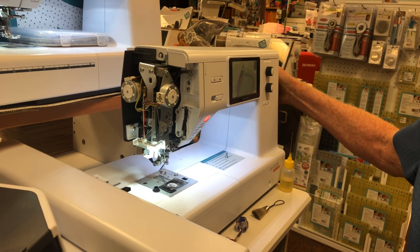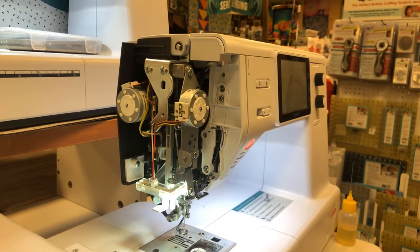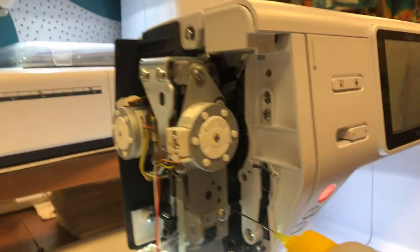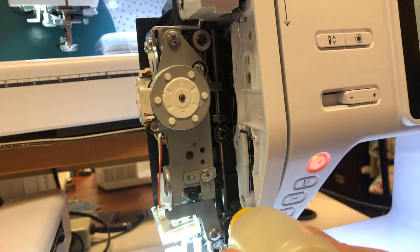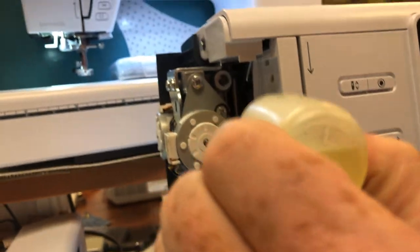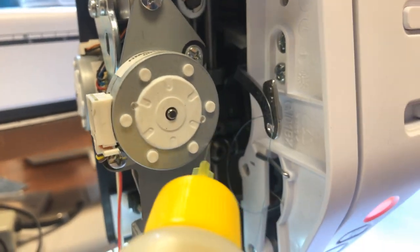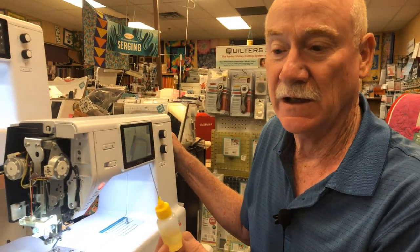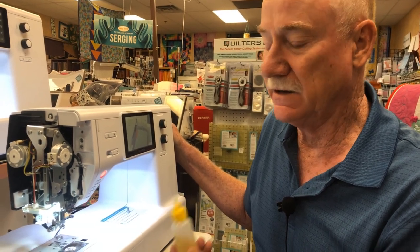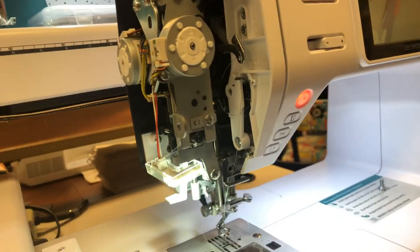Now we've got it all opened up. The instructions say to turn everything off and unplug it, but for video lighting purposes we're leaving it on. Inside here, when you rotate the hand wheel you can see the needle bar go up and down. Bring it all the way up and give it a drip of oil where it passes through the little holes it slides on. Look inside and anything that's cranking around, give it a touch of oil — there's a crank to the right, and if it's metal on metal, give that a little touch of oil. The best oil to use is the yellow cap oil for the Deco and Bernina line. This maintenance is recommended every six months.